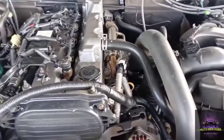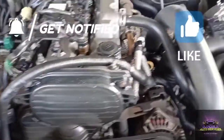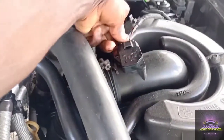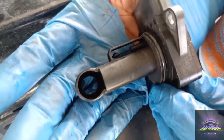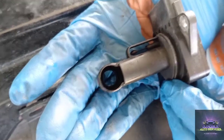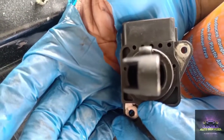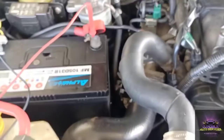The first thing you like to do when you have a no start on these diesel vehicles — we're gonna clean this mass airflow out. We're gonna take it off, make sure the key is off, and clean it up. You see that resistor there — that sensor is the IAT, and the one inside is for the MAF. You can't see anything in there, which means it's really dirty. We're gonna clean that up and check the air filter.